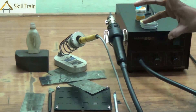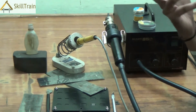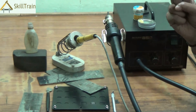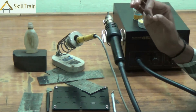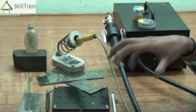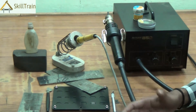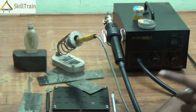Whenever a mobile comes to us for repair, you will try and identify the fault with the components we saw earlier. Most components are easily removable and replaceable, such as the headpiece, the speaker, the ringer, the mic, or any of these aspects. Whenever the problem is not with any of those components, you may need to go deeper to trace the circuitry in the entire mobile device. When checking the circuitry you may come across smaller components where there could be problems. Sometimes while tracing this you may eventually find out that the problem is with a particular IC and that the IC is not functioning properly, so you may need to do the reballing process.